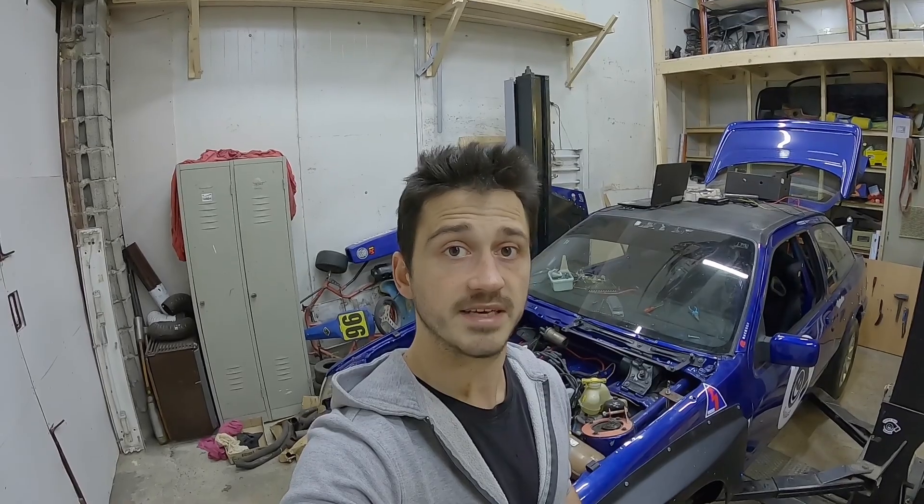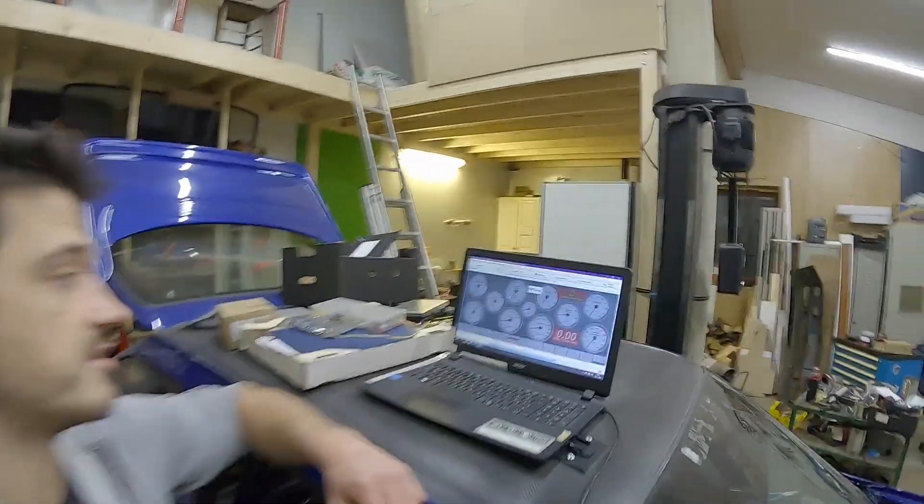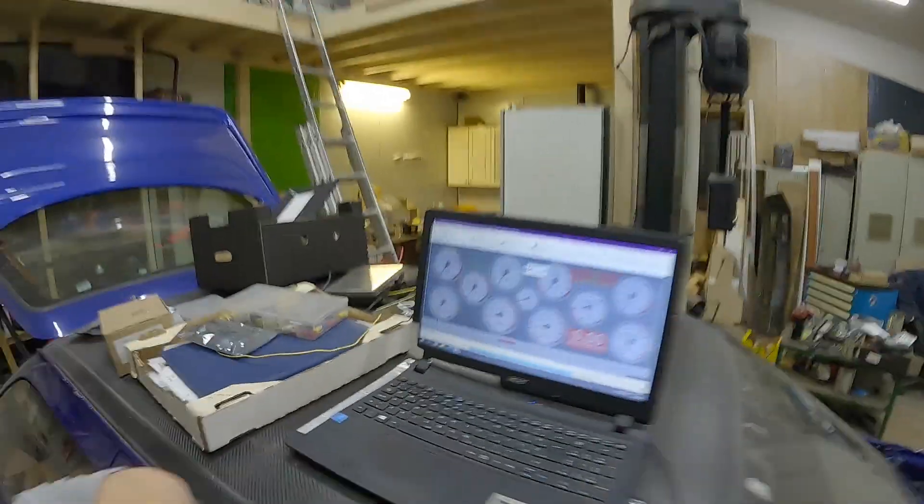It was caused by a sync loss. As you could see in the previous video, I got a sync loss counter set up in the software — here it is. It says zero right now because it's unplugged; it resets every time you unplug the USB port from the ECU, or vice versa — whenever you disconnect the USB connection between the two.